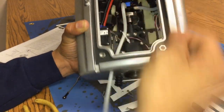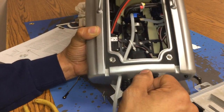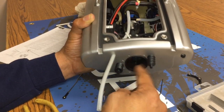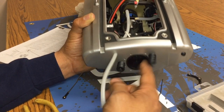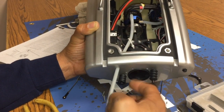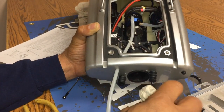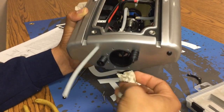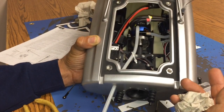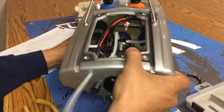The main thing is once you remove the back of the nozzle and the shaft, you can access anything else you need. The only reason I would need to replace the stuffing tube is if I'm getting an excess of water coming in through the hole regardless of how much grease I put in. Once this housing is back on, that's all pressurized with water — the same force that's coming out of the jet nozzles. So if there's a lack of grease, the water will shoot back in through the space between the washer on the back of the impeller and the pump housing and could come inside your boat. If you pull the shaft out and the grease is milky and white, it's broken down and needs to be serviced.